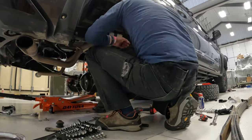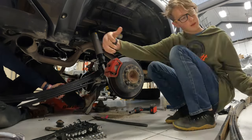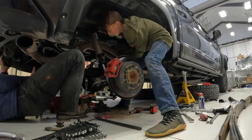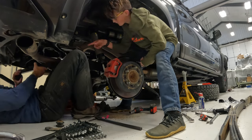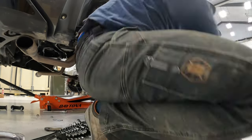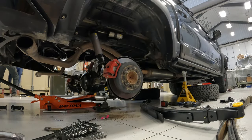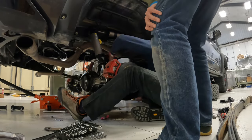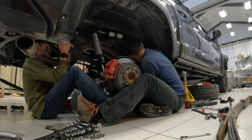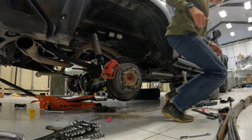The remote reservoir — you cannot cheat this one. The way the bracket mounts, it's on top of the actual frame and it is a little bit tricky to get in place. Here I am putting the leaf pack in — I actually wanted to do a dry fit first just to figure out exactly how to get it, and then I removed the bushings because the Old Man Emu kit came with a greasable bushing.